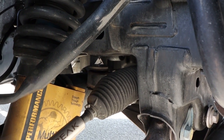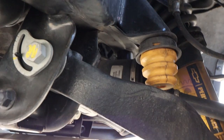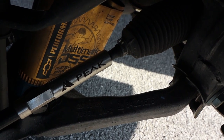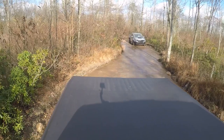For front-end suspension, we also have the one-inch diff drop from Peak Suspension along with the Peak Suspension tie rod sleeves. I have videos on both installs — no issues with them at all, both easy to install and worthwhile. The diff drop lowers the axle angles a significant amount. The tie rod sleeves are a good upgrade because the stock ones are a known weak point. There's been tons of documented tie rod snapping on these trucks.